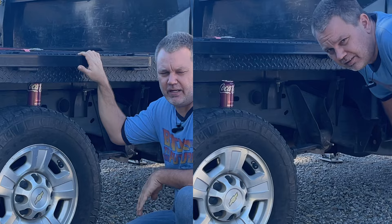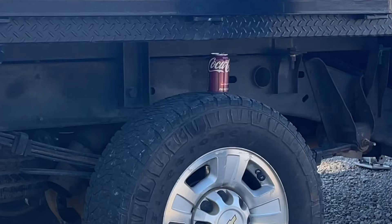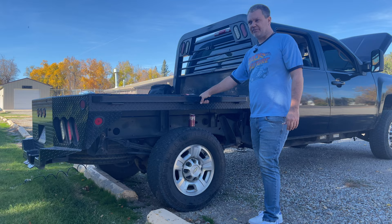I think that's a difference — I think we gained a few inches. That's the airbags. I really like them. I wouldn't ride around with 80 PSI unless I was pulling the trailer. Under normal conditions driving around town, 10 to 20 PSI is about all you want.